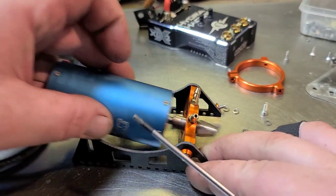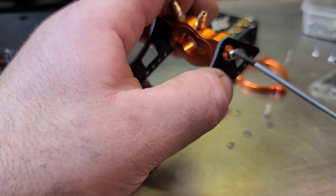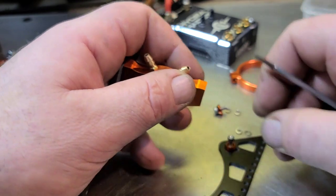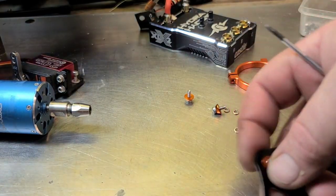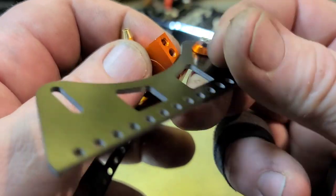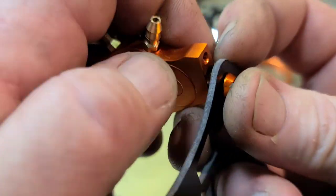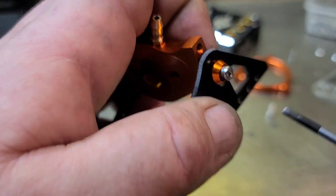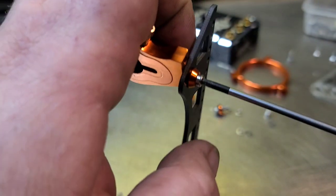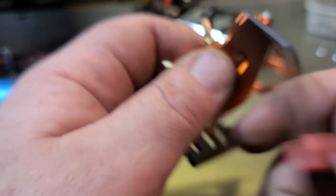Okay, so we're actually going to have to go up to the top hole on the rail, bottom mounting hole on the actual motor mount itself. Okay, that stuffing tube in my boat, it's actually a little bit high, so I might even have to cut the darn stuffing tube down to shorten it up.